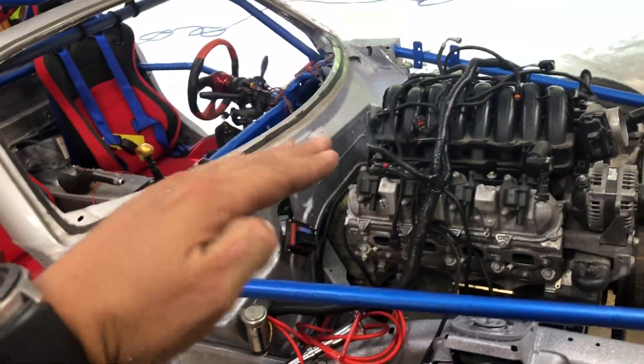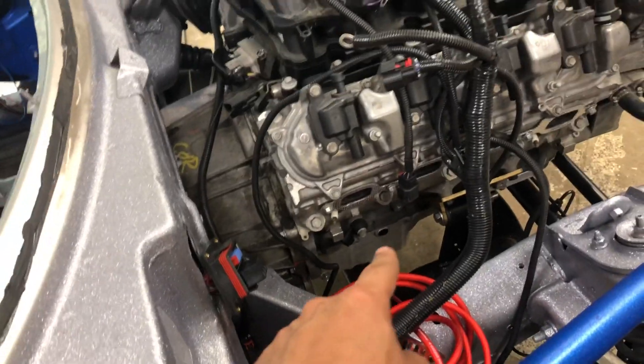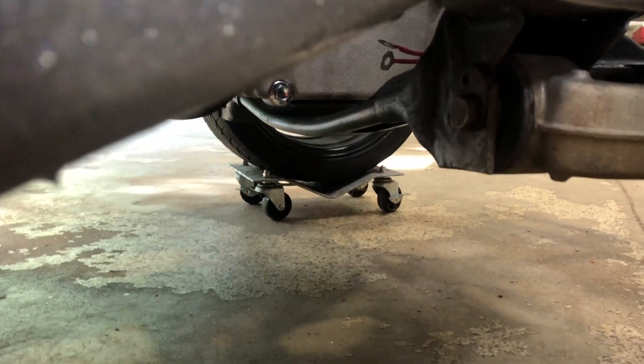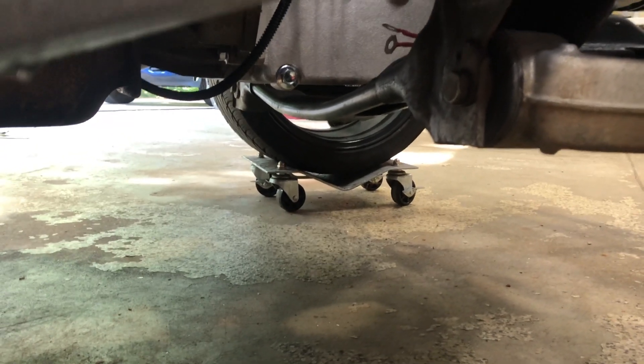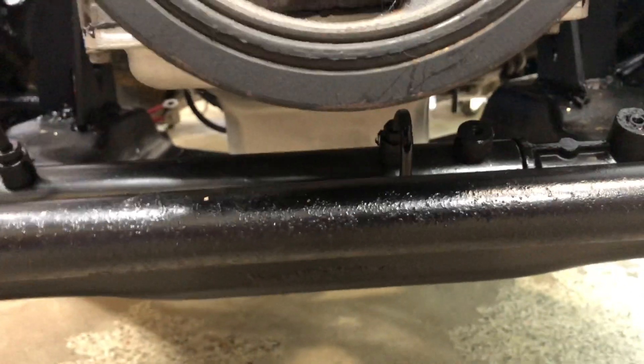We do have the motor sitting very high. Obviously if this was a stock car I do not think it would clear the hood, but with the Holley pan we're able to clear that factory cross member. We've got about an inch of clearance at the bottom, and up front we've got even more. The power steering was what was closest but it totally cleared that, so we didn't have to modify anything - we just put the motor up as high as we could. Hopefully this won't give us too much issue with our drive shaft pinion angle, but we think it'll be all right.